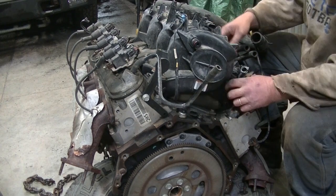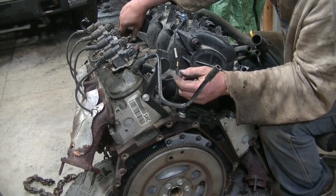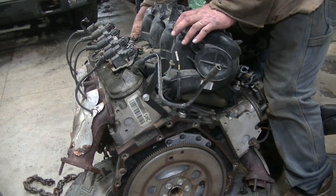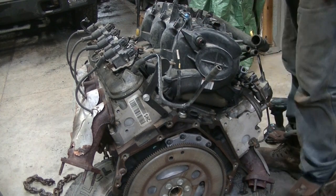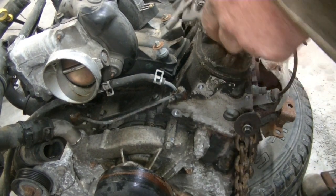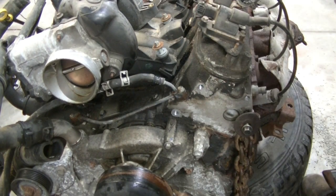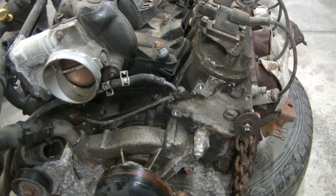And I believe that's it. Make sure they're all loose. Yep, there we go. Did I forget anything? Yes, I did. This line going here to the throttle body. So the last thing I got is to pull this clamp and take this hose off. And my channel locks were right where my wife put them, right where they should be.